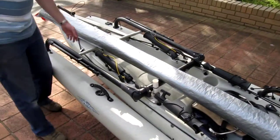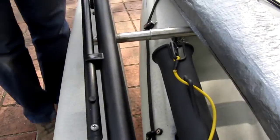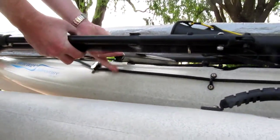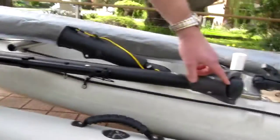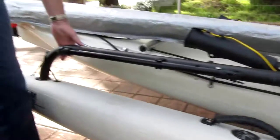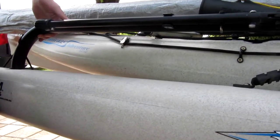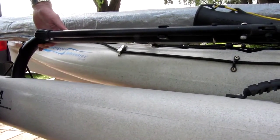We've also got the support bar at the back, what we call the acker support bar, to stop the thing sagging. If we don't actually have these in place, what you see happen is that this sags quite low and puts pressure on this knuckle. The knuckle wants to rotate inside, and occasionally you can jam in the track inside the cross member. By keeping this lifted up when trailing, it takes pressure off the acker and off the aluminium extrusion as it goes into the cross member.